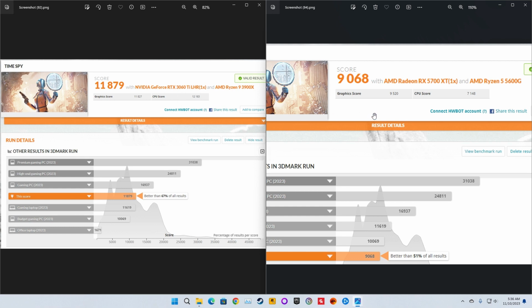That's what happens when you think you're going to do a downgrade. Originally, the system I was going to downgrade to was going to be that X99 system, but to get a decent board, a good board, it was like $100, $150, $200 just for the motherboard, to use the lowest end i7 that X99 could support, I believe. I had the i7 5820K, which I still have, and I still have the 16 gigs of RAM, so it's four 4-gig sticks, so it puts it in quad channel.